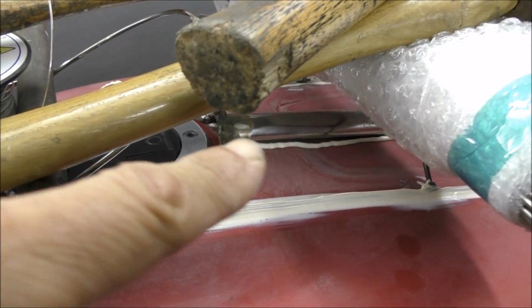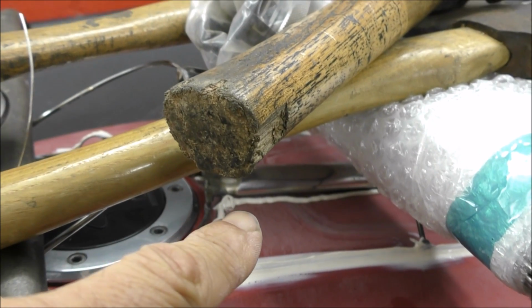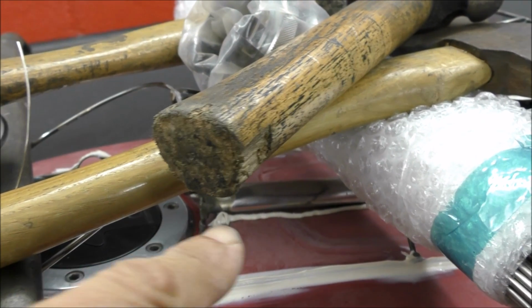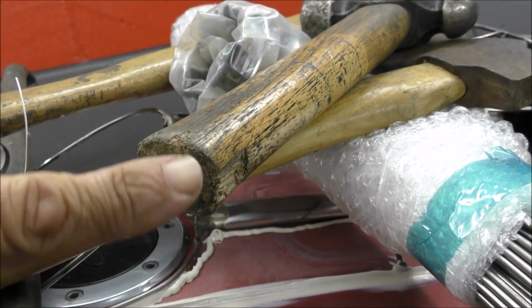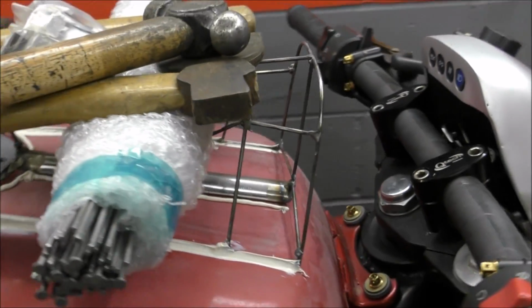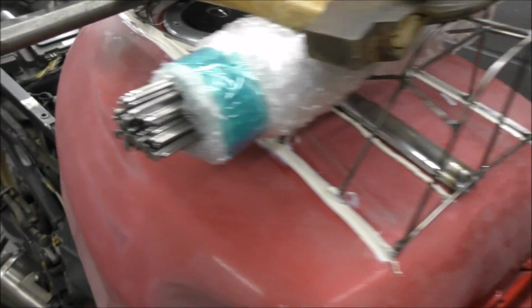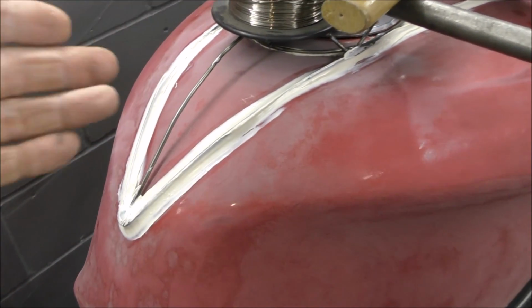Now in there, where the drain tube is, I've left that bead untouched so it dries and becomes hard, and then I'll build another one up on top, then on top. So I'll actually build up to it. If I spread that now, it will just go underneath and bung up the drain, so that's not going to happen. Now it says on the tube, adjustable for 10 minutes and touch dry within an hour, and then fully bonded in 24 hours.